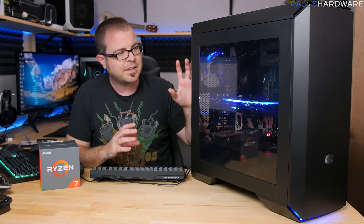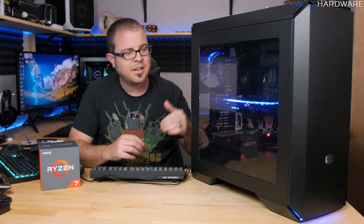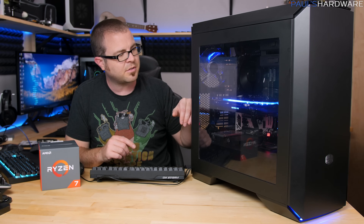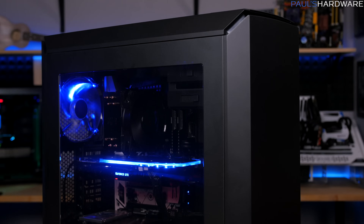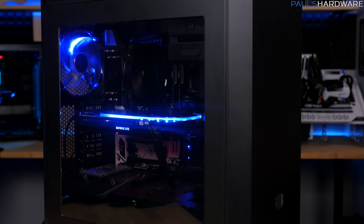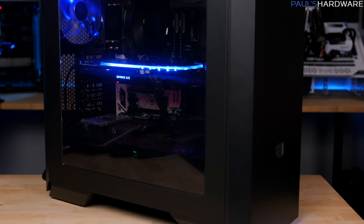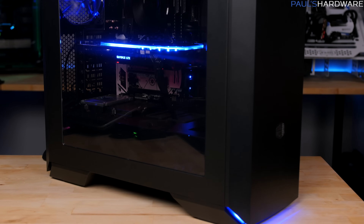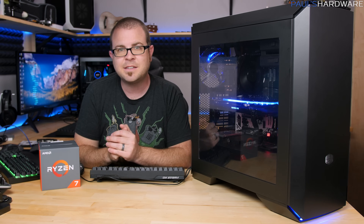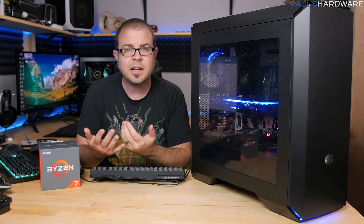I was actually looking at this system as version one — you get everything in there and up and running, but there's so much extra space to add more stuff. You could easily drop another graphics card in there. Additional expansion slots could be used for more storage, a RAID card, a capture card, or anything like that. You've got tons more space for SSDs. I removed an entire drive cage and there's room for more drive cages. Five-and-a-quarter-inch bays at the front. You could add more memory — it's only got 16 gigs with two additional slots available. Tons and tons of upgrade potential with this system.